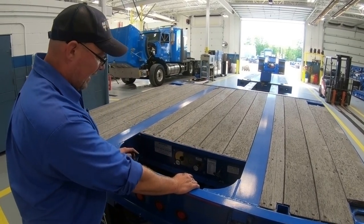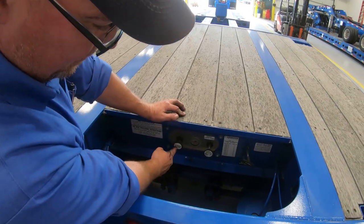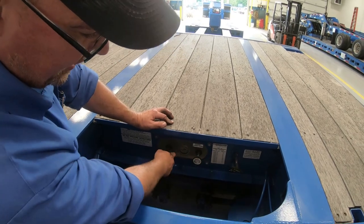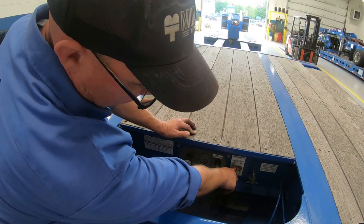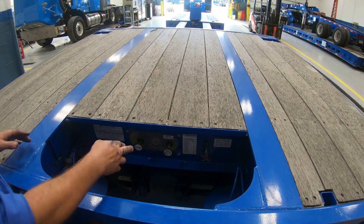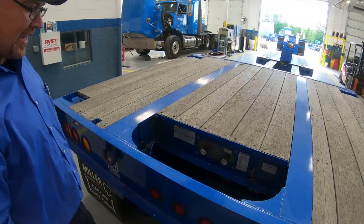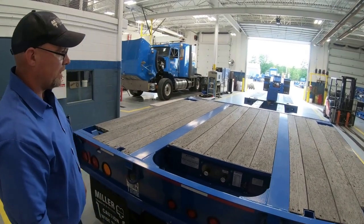One last feature — it has a gauge. When this is in the push, the auto position, running off the leveling valve, and you have your load in there, it's going to register on your gauge. It will tell you right here on the sticker how much weight is on the axle based on your gauge reading. These are pretty accurate — not 100% accurate, but very close. So those are some tools you can use to help you with this trailer.